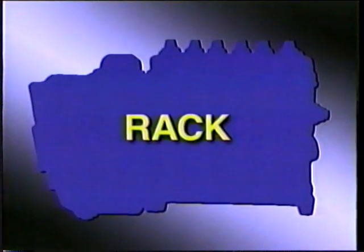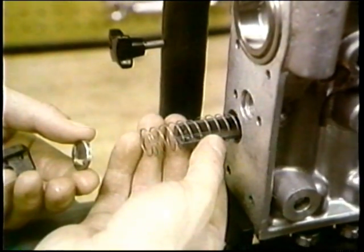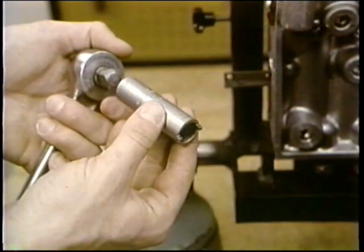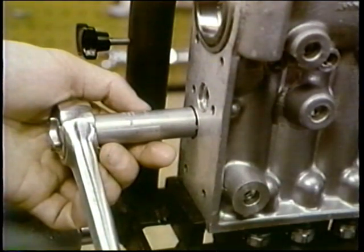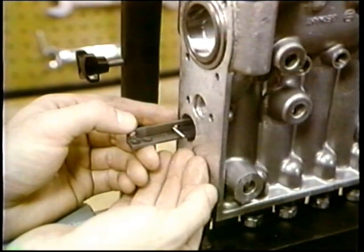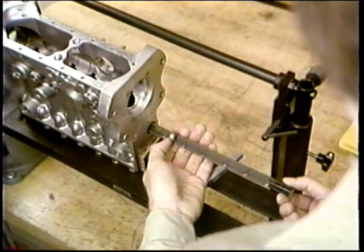Removing the rack is your next step. After you unscrew the block, the seat and spring will come off like this. You'll need this tool to remove the bushing retainer. Remove this pin — now the rack is free to slide out the other end. As you take this out with its bushing, that completes your removal of the rack.